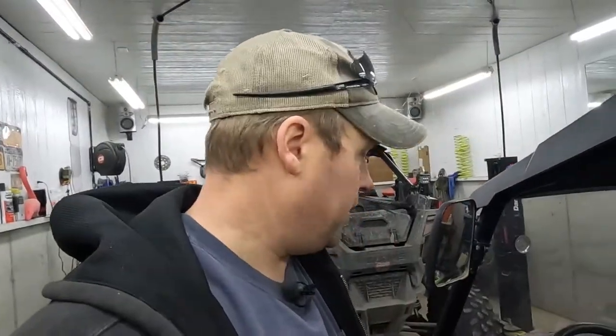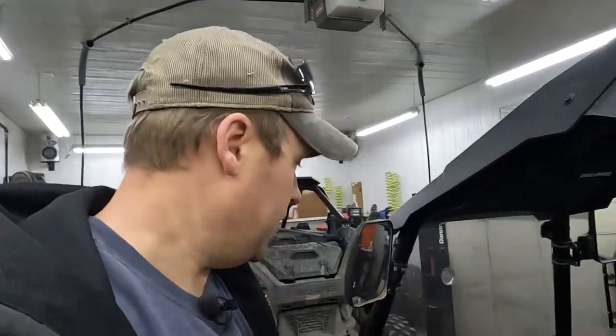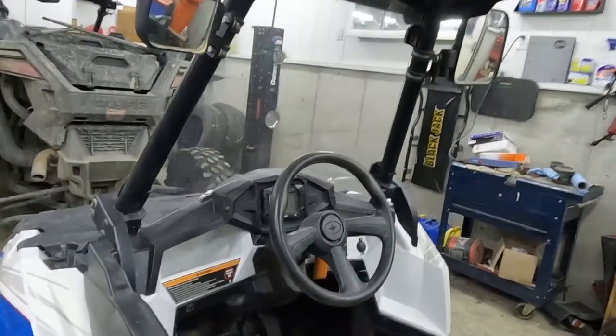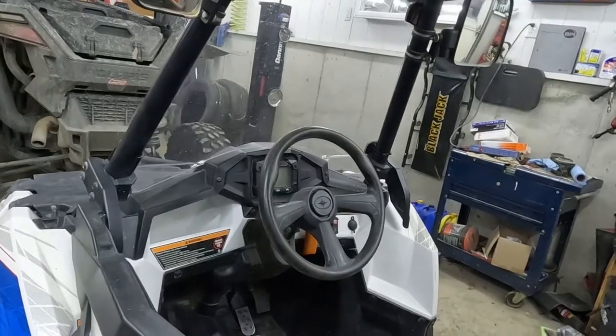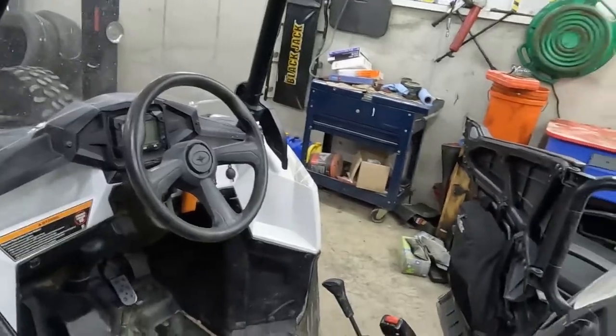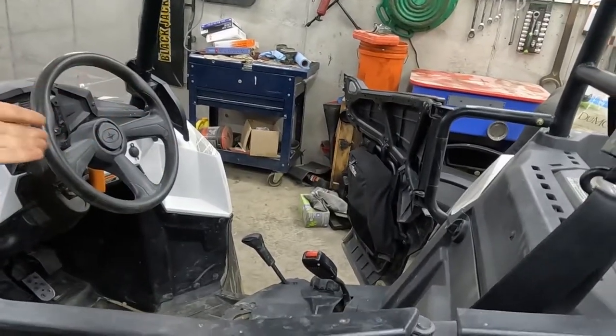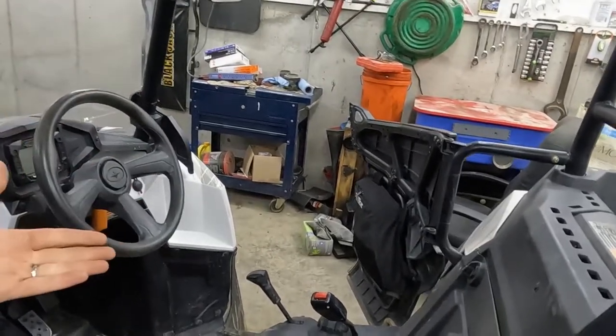A quick follow-up on that voltage, anything above battery voltage is good. It's past what they call break-even amperage, and that just means that you're good. Anything above it. I like to see 14. Normal seems to be 14. I do see them dip into 13 sometimes, but that's what we're looking for. Anything above that battery voltage means that the machine is charging the battery, so it's considered normal.